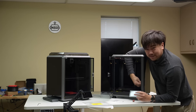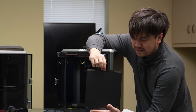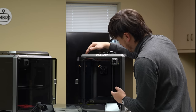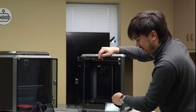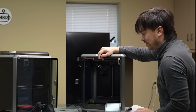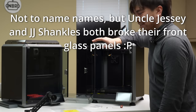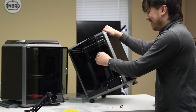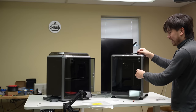I remove three silver screws and the machine is ready to go. There's a one-sided engineering-type plate with a little rubber material — almost like shoe sole rubber — for wiping the nozzle. It's got a magnetic build plate. The only new thing I can see is they've changed the branding up front, with nice lettering showing the build volume and the K1C designation. This hinge is a lot sturdier than the old one — some YouTubers had issues with the hinge door flinging open and shattering. They've put in some nice strong detenting door hinges, so it's good to see Creality took that feedback seriously.